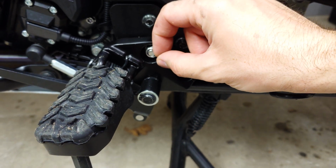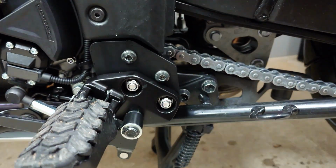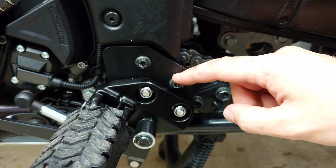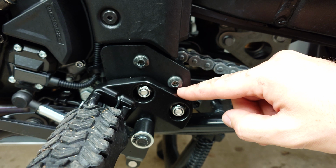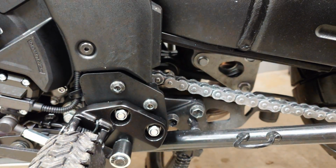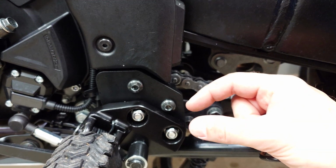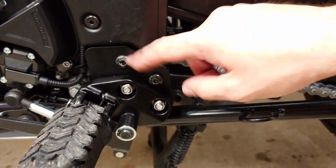So it's, I don't know how much, like 3 centimeters lower. It's very simple to install. You just unscrew these bolts, and it's a 6mm Allen key. They are really tight. So I had to use an adapter for a 6mm Allen bit to a long range. You can find adapters like this, but anyway, they are really tight.